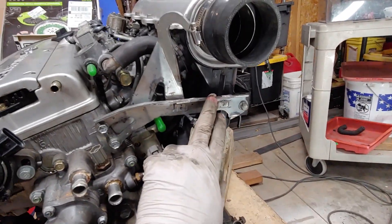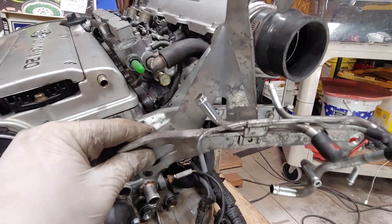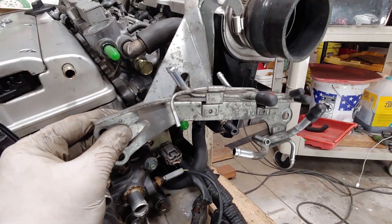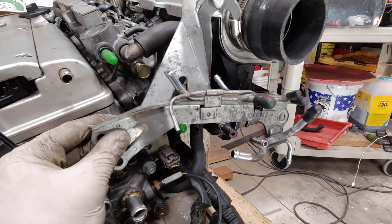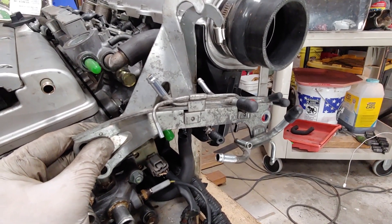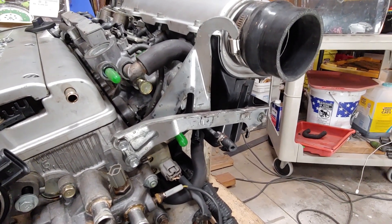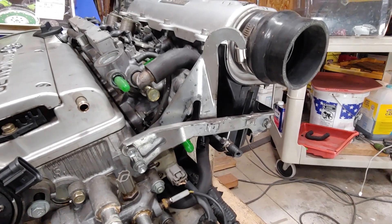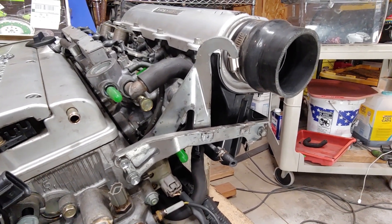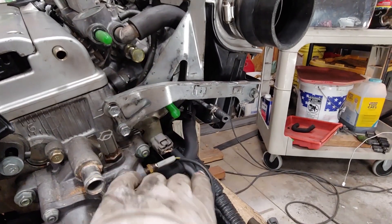There's a little brace here that helps support the intake surge tank and also has the engine hoist hook on it. Here's one that came off one of these engines unmodified — it has a whole bunch of little vacuum hard lines attached to it. I found that none of these lines are really applicable to the AW11. I might regret cutting one off; I need to run one to my cruise control and one to my charcoal canister, but I can tap other vacuum locations to get that.